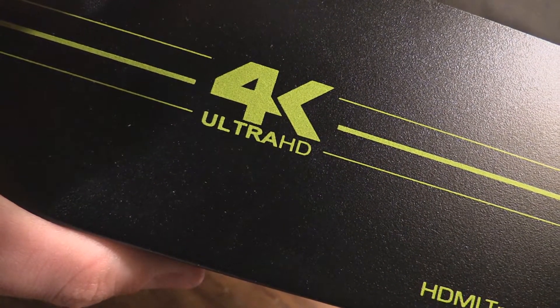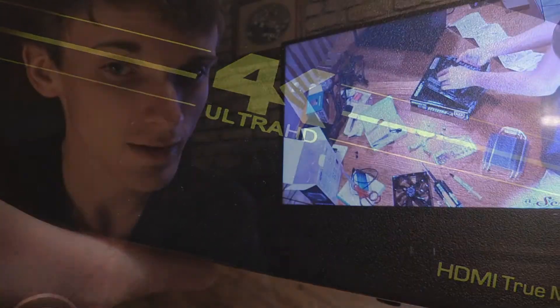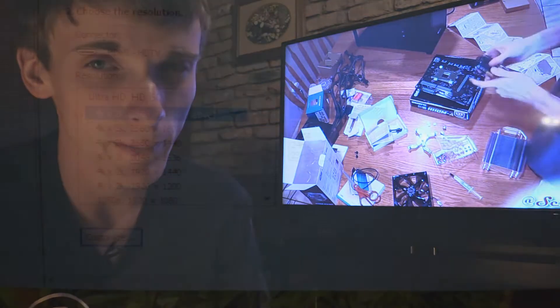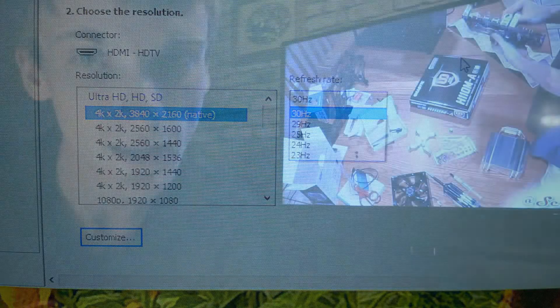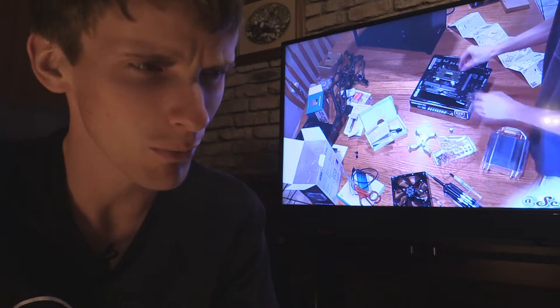Here's the big question: does it support 4K 60FPS? No. I found out the hard way — this does not have HDMI 2.0 ports. I hooked up my PC, which has a GTX 1080 with HDMI 2.0, used an HDMI 2.0 cable on both the input and output going to my HDMI 2.0 TV, and it was capped at 30FPS. That means it's HDMI 1.4. So if you're going to do 4K resolution, you're capped at 30FPS, which kind of sucks.